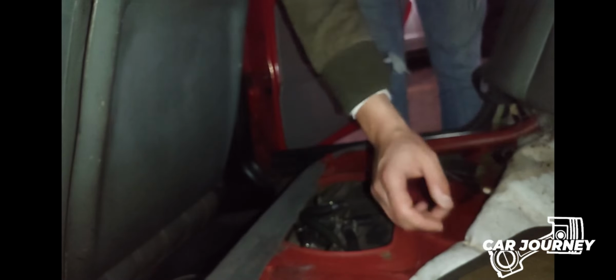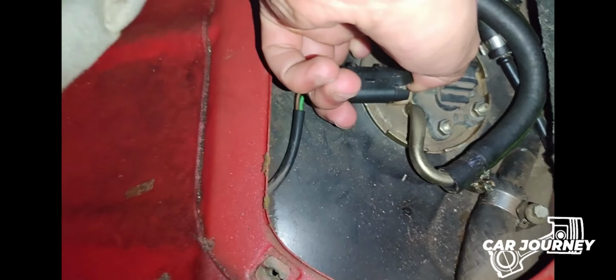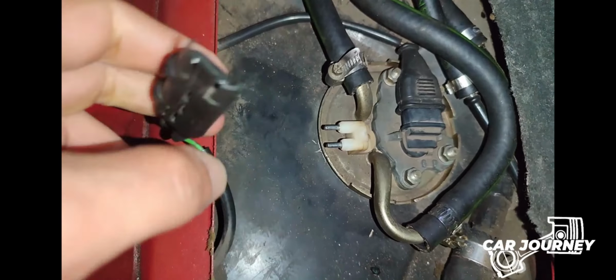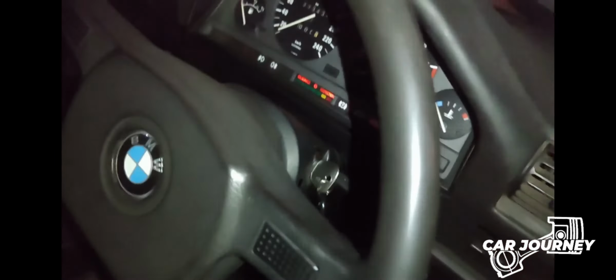So just a rundown on parts. There's a couple of things that I had. I have a Master turbo fuel pressure regulator. I had it sitting for like 2 years. Clean high pressure fuel line, which you can use for oil, brake fluid, all that. Actual automotive fuel line clamps, because the normal hose clamps, in my experience, I've always stripped the stuff, even on the slightest turn. Different diameter fuel line as well, which I'll get to later in the video.